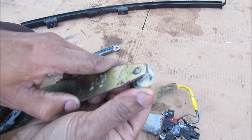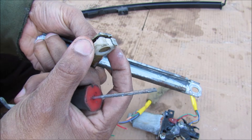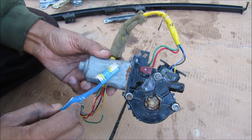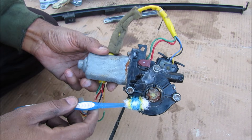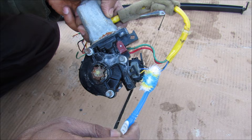The edge of this mechanism is pretty interesting — it has a little bit of a swing to it and a rotation, so presumably this provides a little bit of cushioning for when it slides in the track. Now the window regulator has these two power wires that power the motor itself, and they work in opposite polarity to either move the window up or down. However, there are three other wires that actually go to a limit switch and an encoder.